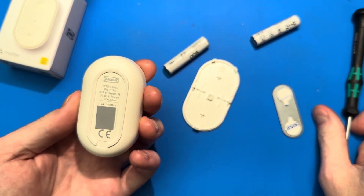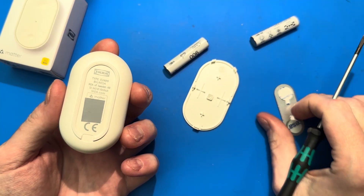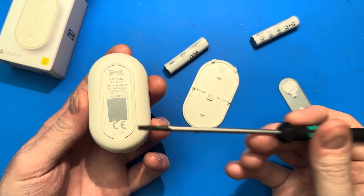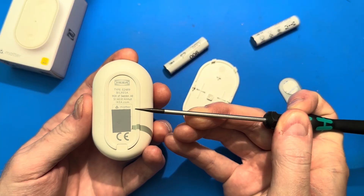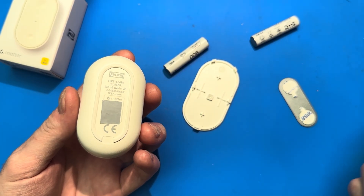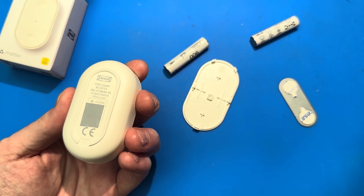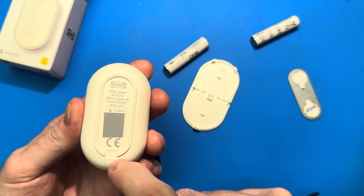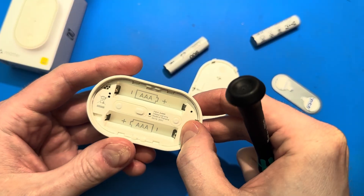This is like a double-shot injection molding where the rubber is part of the mold — it's not stuck on afterwards. That lets it grip the table a bit better, and it doesn't slide down your wall. I've got the Matter code covered there just as a matter of precaution, but it's printed on the back. These are laser engraved, so in the factory each one will have its unique ID laser engraved on the back, which is really nice because sometimes they put them on stickers, and stickers fall off or fade over time, especially thermal-type labels.